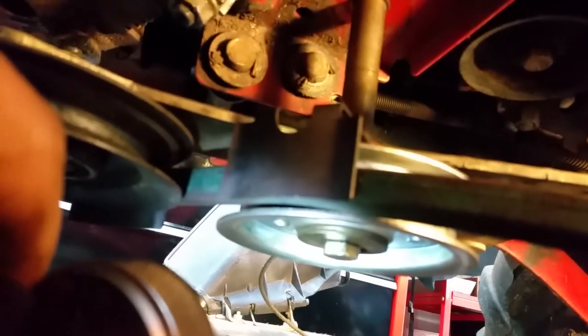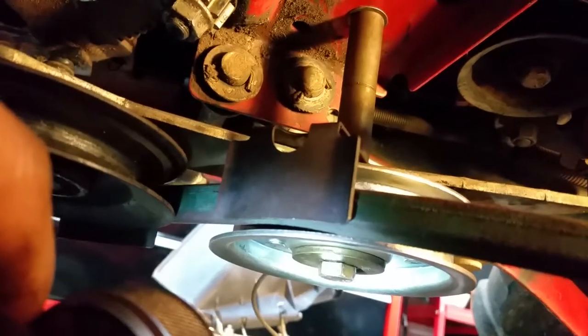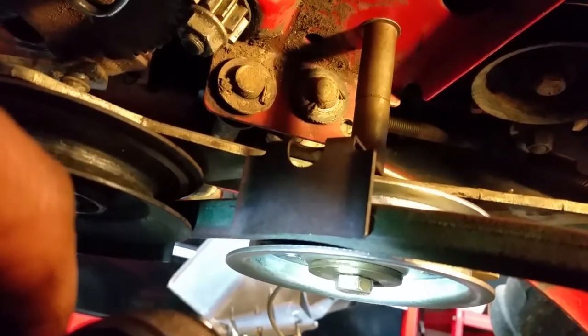Under there you'll have the small washer first, then the large flat washer, then the bolt itself. All that goes up through the main body or frame, and then it attaches to the nut right behind that cluster of wires — hold that in place with your 9/16 wrench.